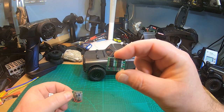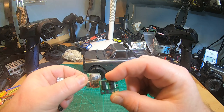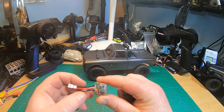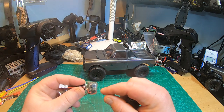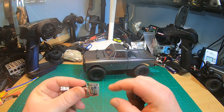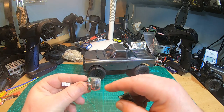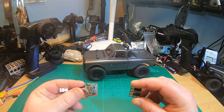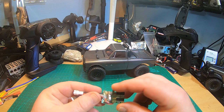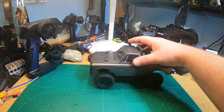The small AS12-16RW with its awesome performance needs a BEC. From my previous videos I know that many people have problems with the BEC and how to install it — but it's super easy, you don't have to do it as complicated as I did. At the end of this video I will explain in detail with larger BECs how to mount it and what options you have, but first let's check the driving behavior as it is.